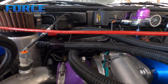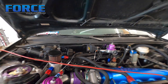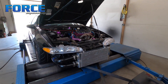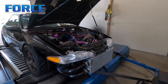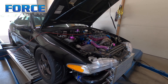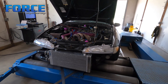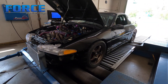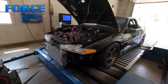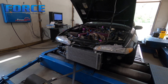So this is a drive-by-wire car - I forgot to mention that earlier - and there's just not enough of a lip on the throttle body. That said, I'm comfortable with the tune-up, so we're gonna send this thing on down the road. He's gonna fix that throttle body flange and then we'll work on some of the boost control stuff once that's sorted out. As far as the fuel and ignition timing goes, I'm happy. We just won't be able to give him a solid finished dyno number for now, but maybe we'll talk him into coming back and making a hit later.